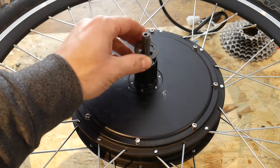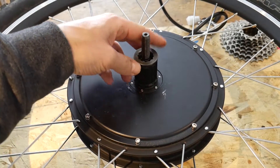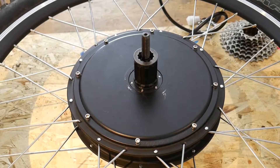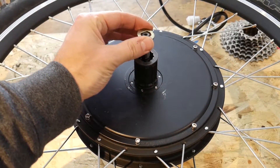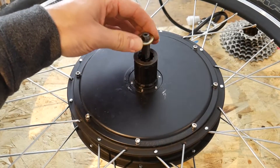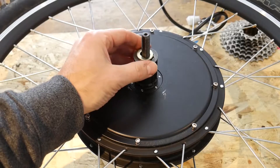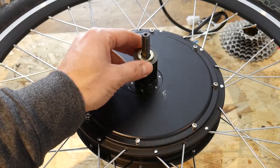The spacers included with the kit do not fit. If I put the lock ring back in place, these spacers don't fit inside of the splines on the lock ring — you'll see them sitting on top, they do not pass through. And that's the big problem here.